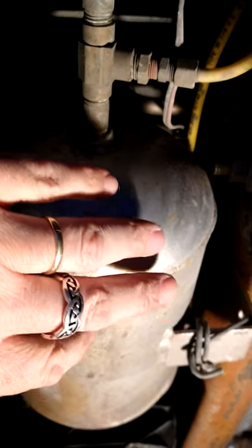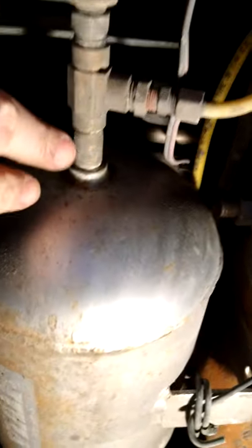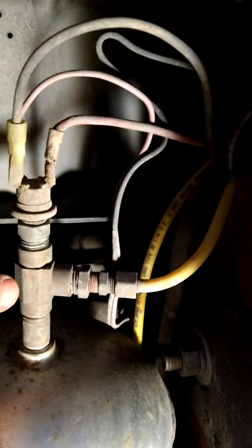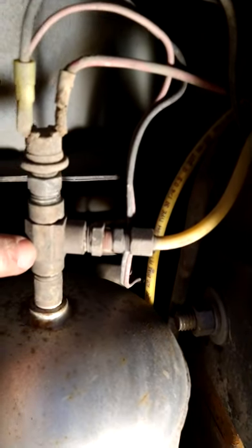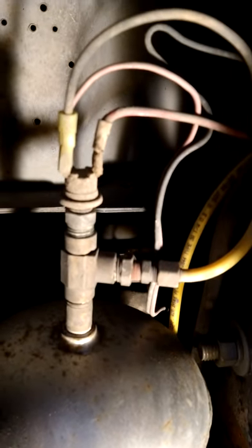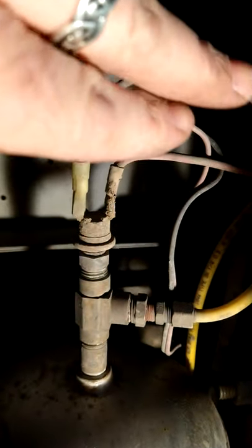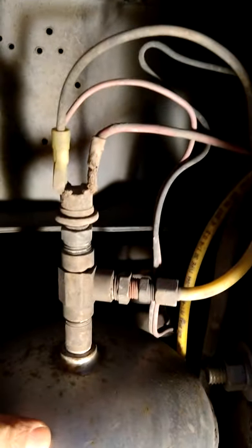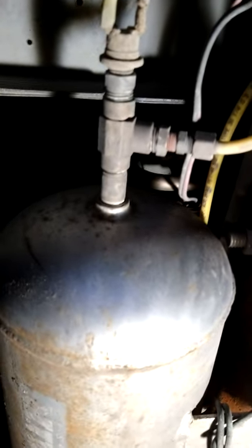I threw this together at the time — this was like $20, though prices have really gone up. It bolts right to the frame there, and you've got your air port going out to the horns, and then this here comes in from the compressor. There's a check valve, the airline just fills the tank up, and then you've got pressure all the way through the quarter-inch line to the front. When you honk the horn, it lets the air out through those two solenoids.